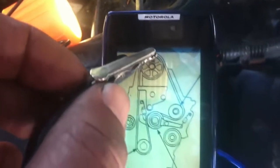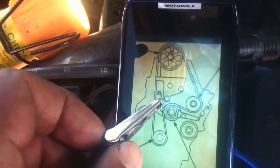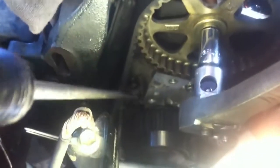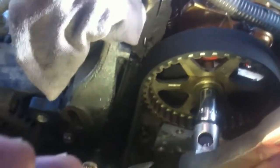So as that side's tight, this side's going to loosen up, and the spring here — this spring right there — is going to pull up on the adjuster arm that's in the back there. I don't know if you can see it, but there's a spring down there. Hold on, let me get the arm. This spring right there — that spring is going to pull up. But we're going to help it though. What we have there is a little wire right here. We have a wire attached to the arm — tight wire.